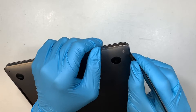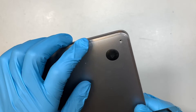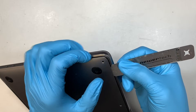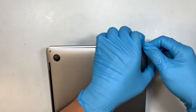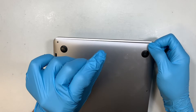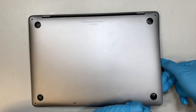What I'm trying to do is go in between the back plate and the base of the computer and then pop it open. There's a clip on the side — no screw holds it on the side, they use a clip — so you need to put some pressure and pop it open.